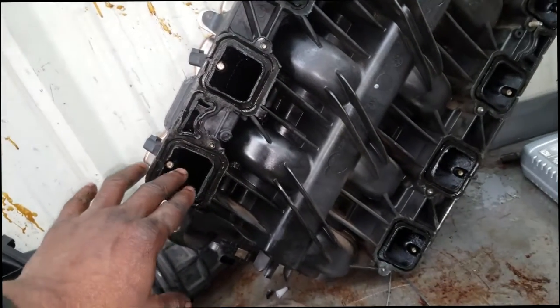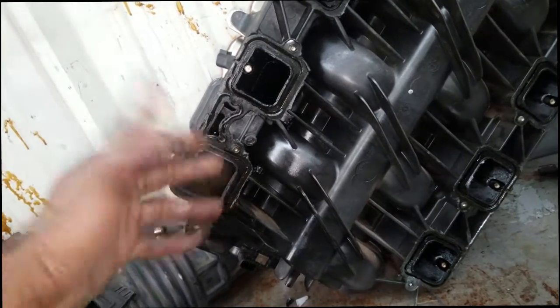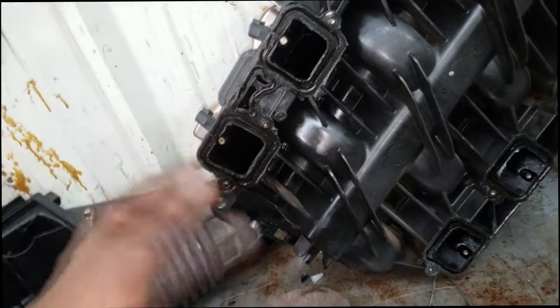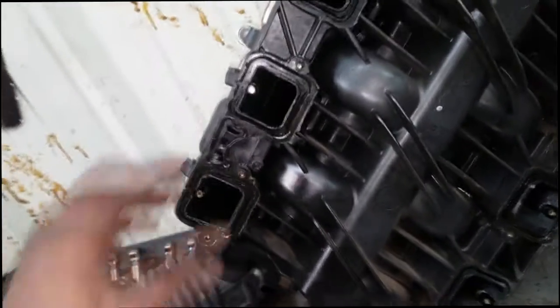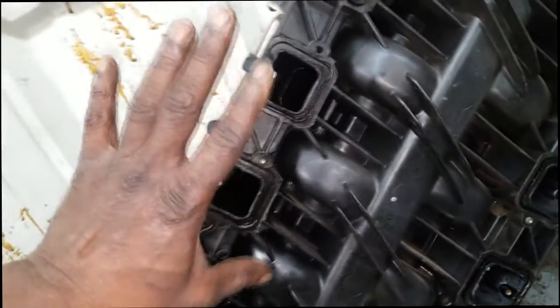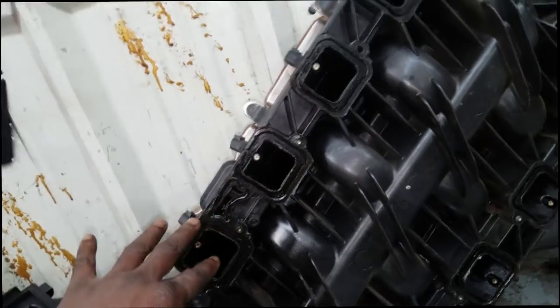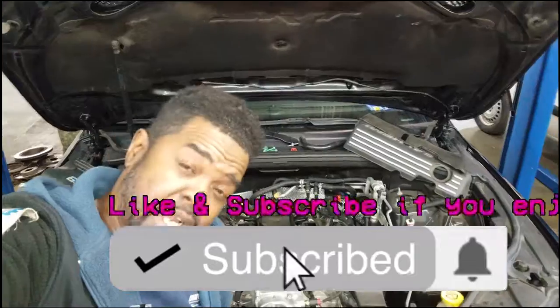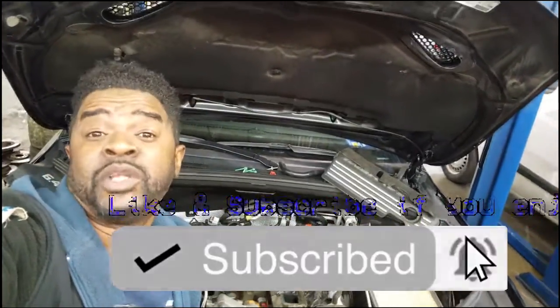We have to recommend he replaces the intake manifold, and it's not over after that — we have to go further and find out if it basically overheated because it was low on coolant. The water pump was leaking, so that very well could be the case, but we don't know until we get a new intake manifold, install it, and go from there. Nothing major — just felt like vlogging. Thanks for watching, comment, subscribe, and I'll see y'all in the next video.